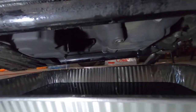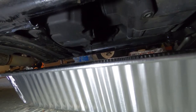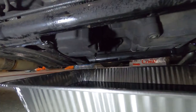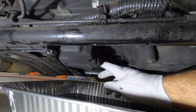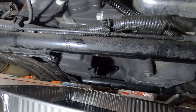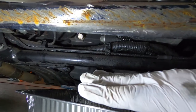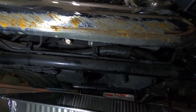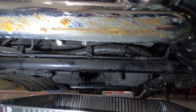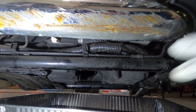You guys can see the oil draining is almost complete — leave it for a few minutes. I'll try to hold the bike straight up so any remaining oil drains. Mainly for the transmission, I prefer to have the bike flat so any remaining oil will drain out. We'll be back after we drain everything, remove the filter, change the filter, put the drain plug back, and then drain the transmission fluid.